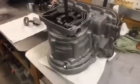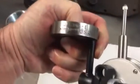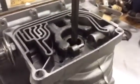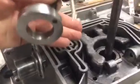First thing you need to do when checking that clearance is set the PowerGlide on its backside like that, because the planetary hub can move up and down right now and you want it to be all the way down in there resting against the thrust washer on the backside — so you know it's bottomed out and that's what your running clearance is. Next you're going to need the proper J tool — it's J8364-1. This goes down on that planetary hub and lets you take a measurement. I've got a dial indicator hooked onto this tool, and you want to set this tool on the flat mating surface, the gasket area, because that's where we're going to measure from.